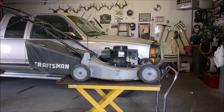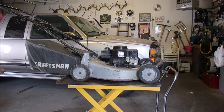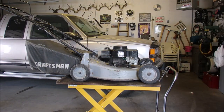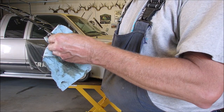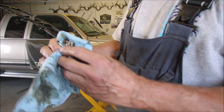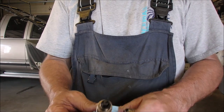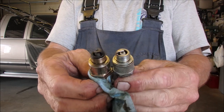See? There's no hammering. You can hear the spark hit the ground. So it's got a good coil. Now, where is this E3 plug versus our other plug? I don't think this plug's going to be any part of our problem, although it does go a skosh deeper into the cylinder. This is hot. Woo! So even unscrewed in, they run, you know?